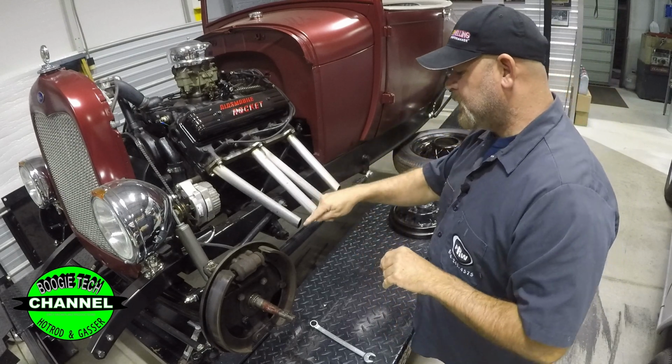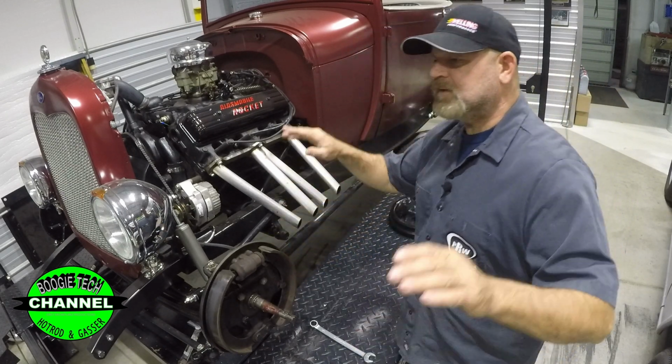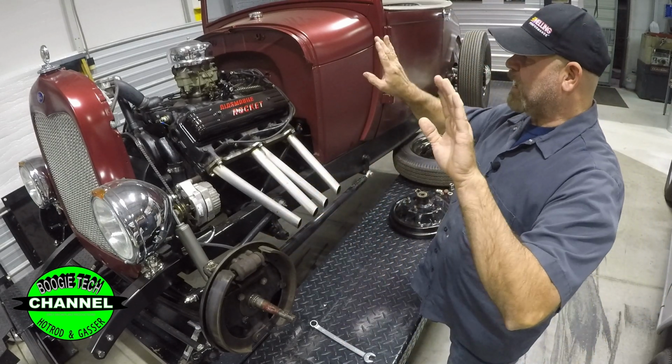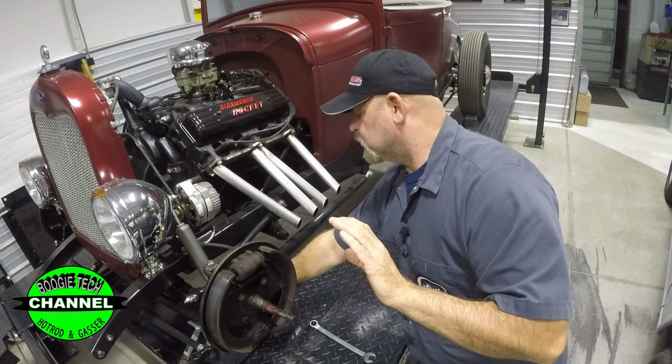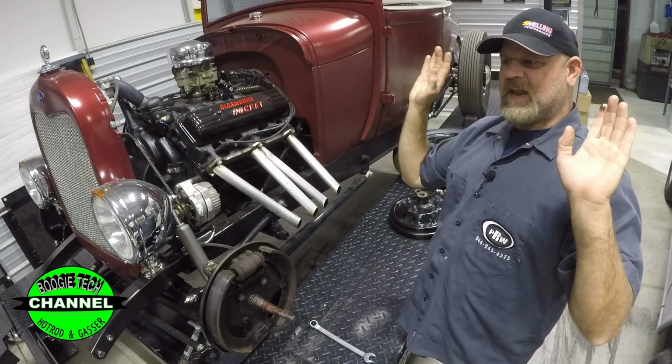But what you do when you build these cars, you can cut them, or you buy this wishbone that the caster's put into already. They make a wishbone that looks like this in the bolting surface here. It's got a kick in it. Well, the kick's for caster. It lays that axle back.